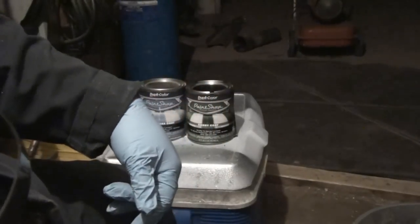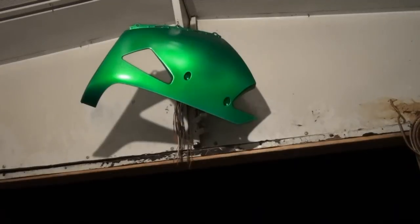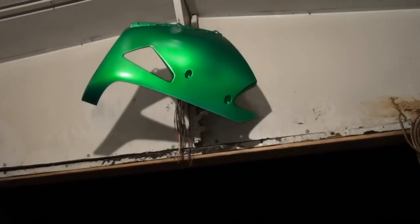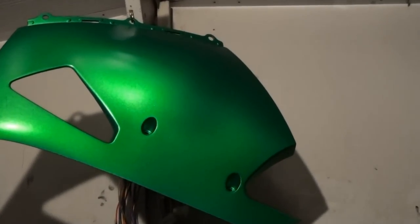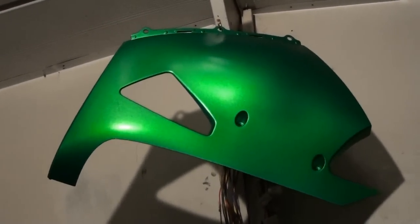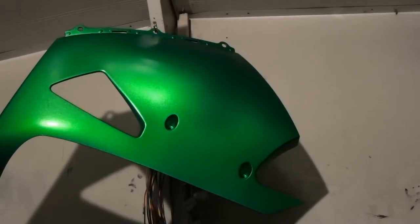I'm not going to be doing that part tonight. I'm going to be continuing on this piece that I have hanging up here. As you can see, I've already started to paint that — I have about two coats on there. The lighter the coat, the kind of weirder it looks; it kind of looks like a turquoise, it doesn't look so candy green. I'm going to do at least three to four coats so I can get the dark candy green, because I like darker green colors. I could probably just get away with throwing my gold flakes right now, but I need to go a little bit darker and still match the other panel I painted a while ago.